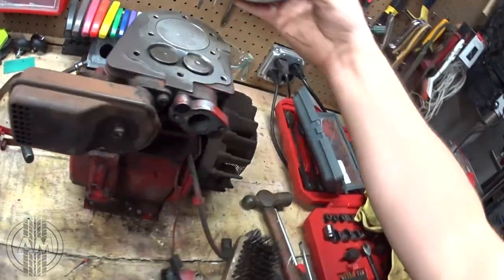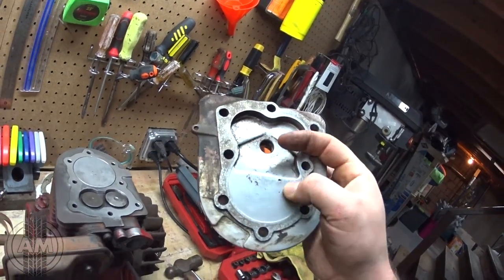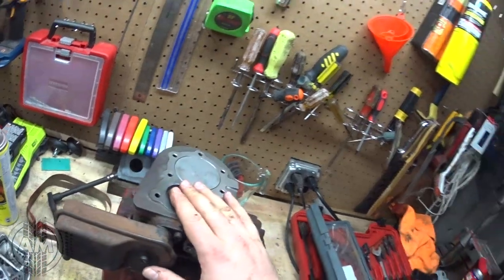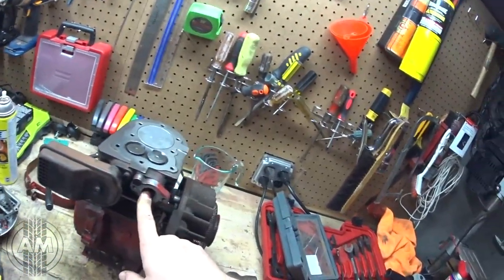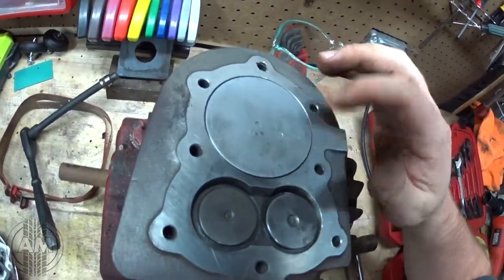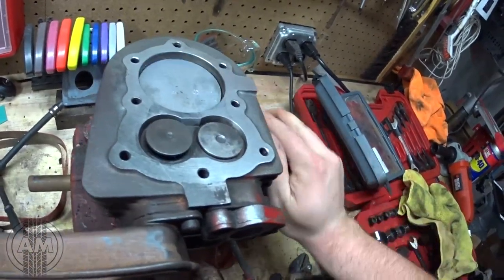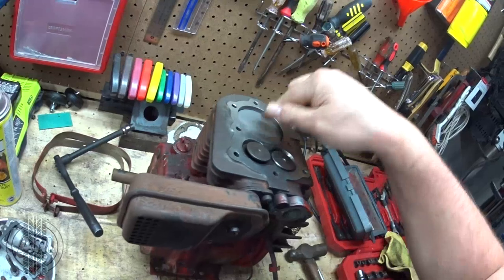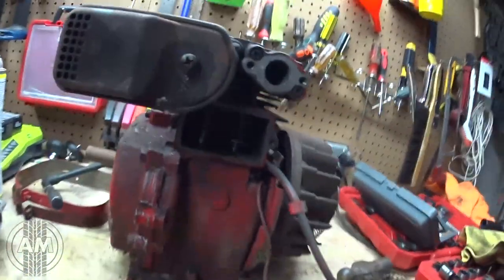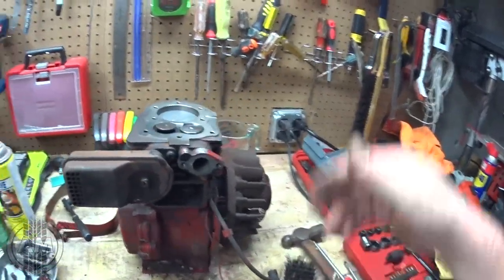I got it pretty well cleaned up. On the exhaust side there's a bunch of divots all in there, and there's divots on the head where the piston comes up and down. I have a feeling something got sucked into this — a lot of the stuff that came out was brown, not black. So I'm wondering if dirt got sucked in the carburetor and clogged it up. There's a little nick on the top of the piston — I think that's a maker's mark. There's also a little rocking noise that is very unnerving, and it's not the wrist pin — it's definitely down in the valve train. I don't know if there's any way to adjust those valves; it doesn't look like there is unfortunately.